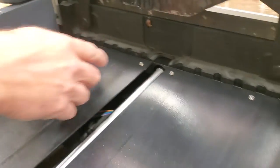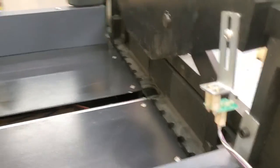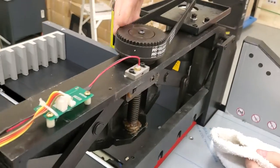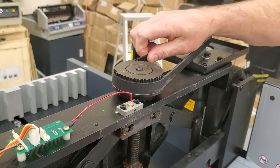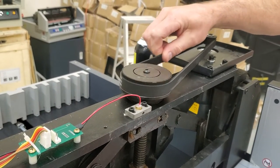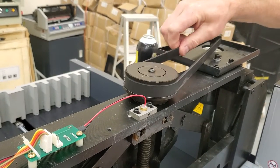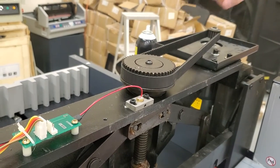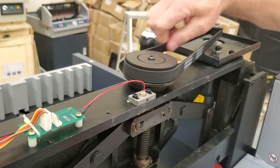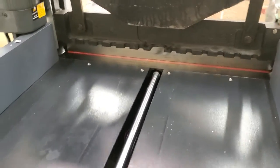Get it as good as possible. Come around back — here's the back part. You're not going to be able to get it because the clamp is in the way, so what you need to do — the clamp is all the way down — is pull on the back part of it to lift it up. It's usually stuck when it's down, so just rock it a little bit. Don't get your fingers cut in here — keep your fingers in the middle and just rock it. Hit it a few times and it'll break loose, then it should go smoothly by hand. Bring it up by hand with the cutter off.